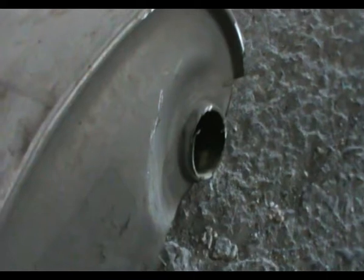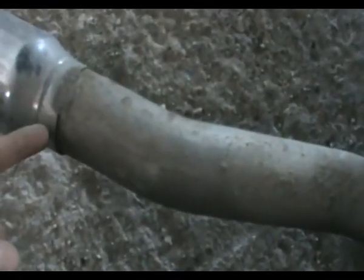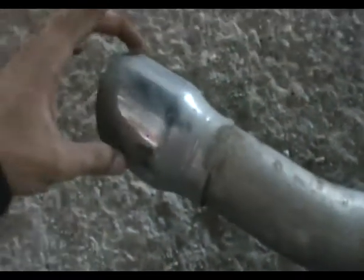Here's the old one — we got it out. That's where I cut it from, as close as possible to the muffler. This is the top of the muffler; you can see the damage — that's why my engine was so loud. Make sure we take these rubber hangers and hook them up to the new one. These are the things that attach to the chassis of the car. Also this chrome tip — the beautiful tip on the back — unfortunately it's welded to the old one. So take your grinder and grind it over here to break the weld, so you can remove it and attach it to the new one.